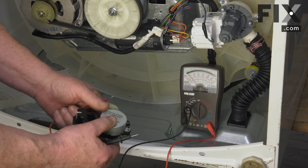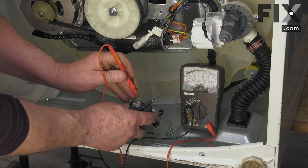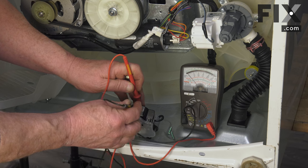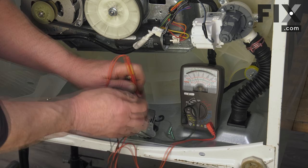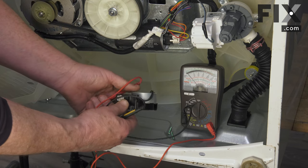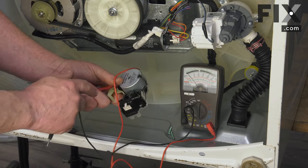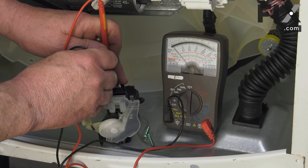When we check the wires going in and out of our motor, we want to see the same thing happen. I've already done this, so I know it's these two wires for my motor — that motor shows good. If you do that same test and there's no deflection and no sound, then you know the motor is bad.